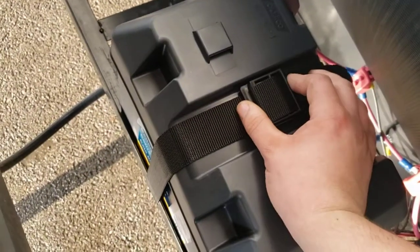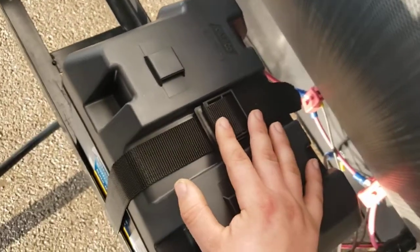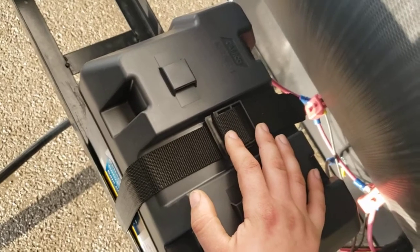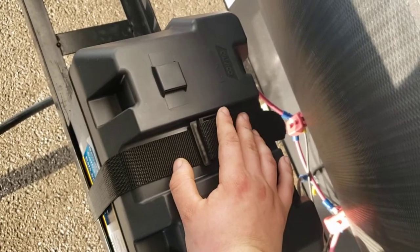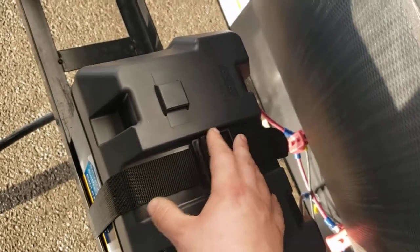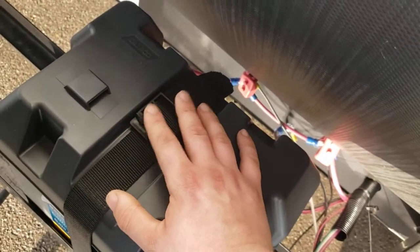Get a Group 24 battery — it's an RV/marine grade battery. In the winter, I recommend taking the battery completely out and storing it somewhere warmer, like your basement or garage, because the winter is harsh on these batteries. If it's going to be a couple of weeks between trips, recommend disconnecting the negative lead so nothing is using your battery while you're away.